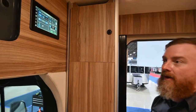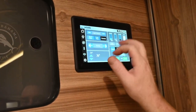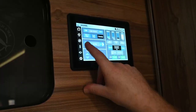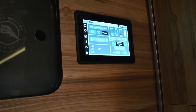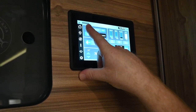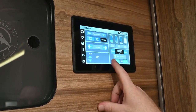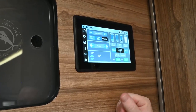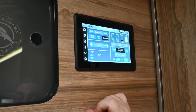Now we're going to talk about your Firefly system. This is the multiplex system — this is the home screen. From here you have the master light switch, which will turn off the interior lights but not the exterior, and you also have some dimming options: low dim, medium dim, and cinema mode. The cinema mode is going to draw the shades when they're up and turn the inverter on, facilitating you watching a movie. If you can't remember what dimmer you're set on, just hold your finger on the on button and it will reset at full brightness. From here you can also extend or retract the awning. The HVAC display shows whether it's on furnace or air conditioner — a snowflake or a little flame — and you can adjust your target temperature with these arrows and display the internal temperature in between.